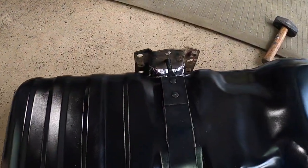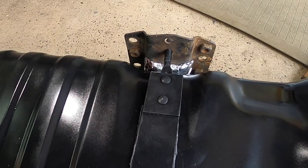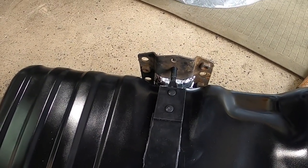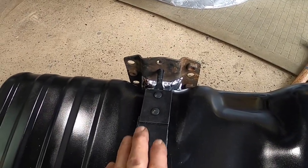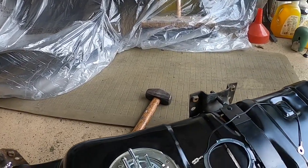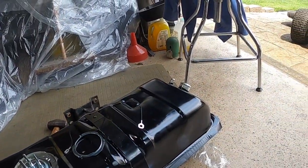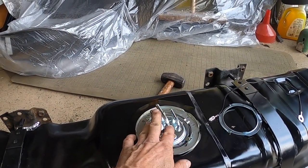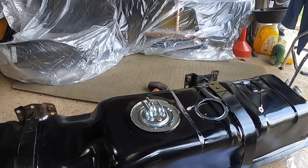All right, well, we got the clamps on there, and like I said, I learned a lesson. I cut these whenever I took them off, and it's all coming back to me now. You leave these on, they hold it, and you take the 8 bolts out, and we got, what is it, 5 hoses: the filler neck, the overflow, and the vent, return, and feed out.